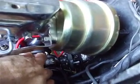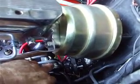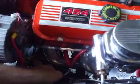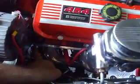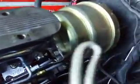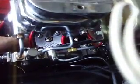These are the two hoses that you need to order for your box so they're the right length. These screw right in here, the power steering hoses, and they go over here and hook to your power steering pump. That's just a generic power steering pump. Now, the CPP 500 box mounts directly to your frame. It doesn't need an adapter on the 55 to 57 Chevy.